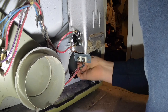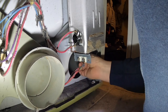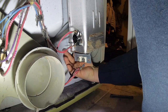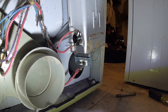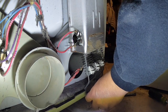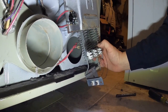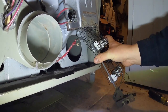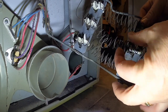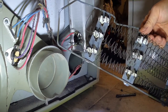If you don't have one of these ratcheting wrenches a regular 5/16th wrench will do — it's kind of in an awkward position but you can get to it. As you can see right there, that's the culprit — that heating element broke. Just thermal cycle after thermal cycle, these wires fatigue and they end up breaking.